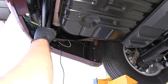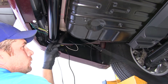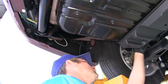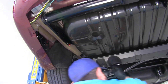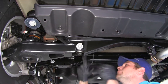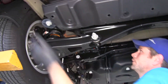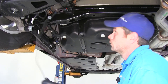Now we're going to run our 12-volt power wire up to the front of the vehicle. The battery is located on the driver's side in that front corner — that's ultimately where we want to end up. I'm going to go right over the top of the hitch here. We really need to avoid any sharp edges or significant sources of heat. We'll pull a little bit of tension in it and then anchor the wire out further ahead. You can see this crossmember here — that gives us a really nice secure anchor point so we won't have to worry about any wire hanging down. You'll see right here are the brake lines — we'll just work around the fuel tank and try to tag along with those while we head up front.